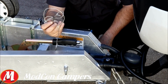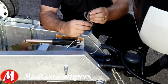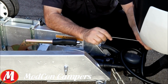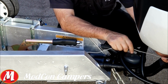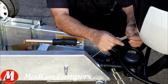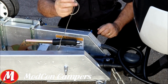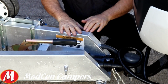Next step, on this particular trailer, being over 2,000 kgs, we're required to have a breakaway system. That's what the lanyard's all about. I'm not going to hook this up in this case. They're fitted to individual vehicles. What we have to do is just have that plugged in so that the lanyard pulls on the plug, pulls the brakes on the trailer just before the chains take up. So we actually have to modify this for every individual vehicle. That's in another video separately to this if you want to learn more about that. So on to the next stage.